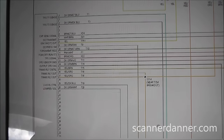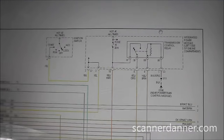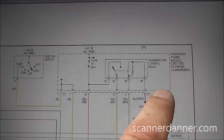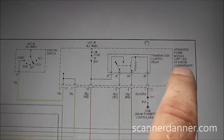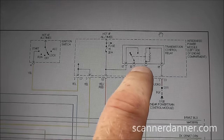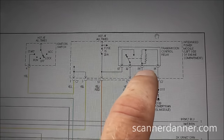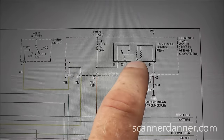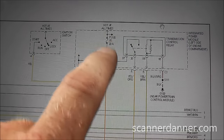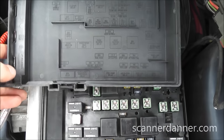We're going to run up to the relay and do some relay checks. When checking relays there are some things we can do right away. I did initially pull the relay out — it's in a power distribution box and I can't get to the pins underneath. We'll pull the relay out and look for two power feeds: one should be hot all the time, and the other should be hot when I turn the key on or start the car.